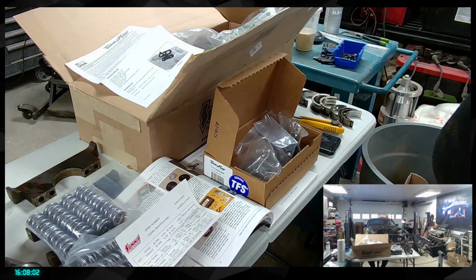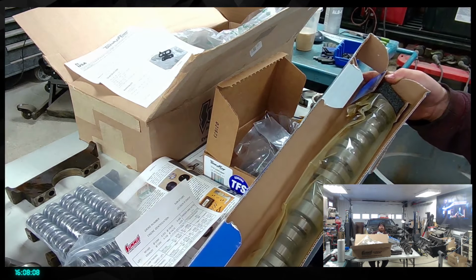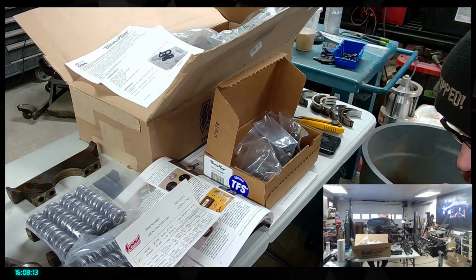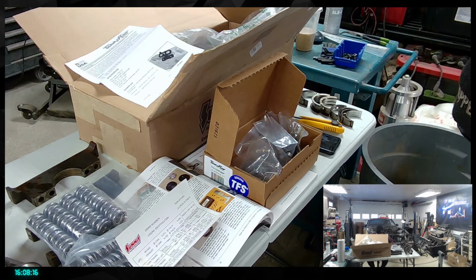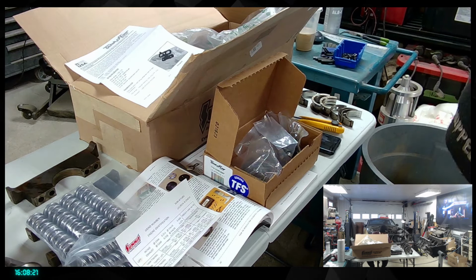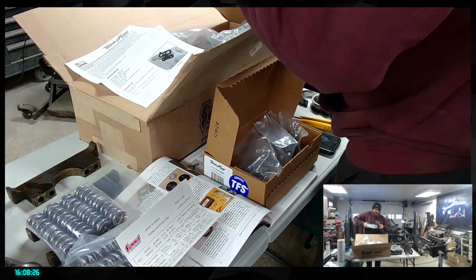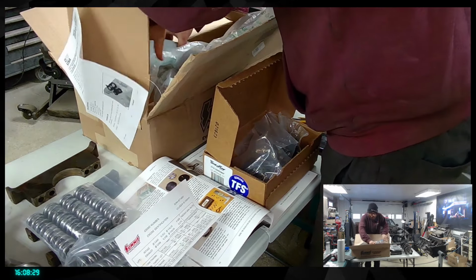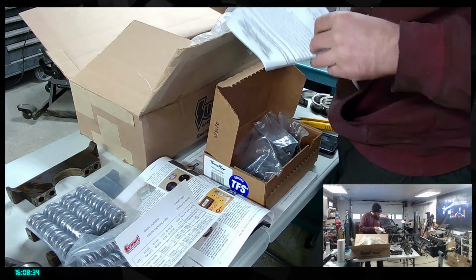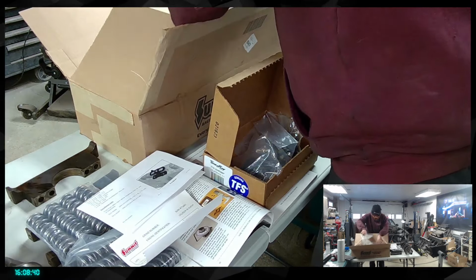So we have the camshaft right here, all oiled up, all looking pretty, and all sealed. This is the cam that's going to go choo choo. I bought a turbo cam, so I'm not looking for that aggressive V8 sound especially. I'm really just looking for something that will spool the turbo soon enough, so a bit more aggressive down low instead of at high RPM. And we're going to look for that amazing result. Here we're going to use that to also figure out what tools we need to buy.